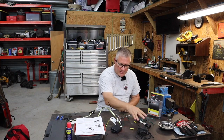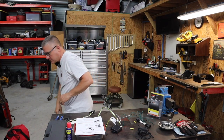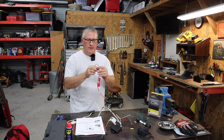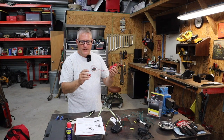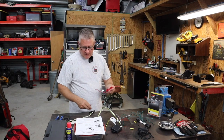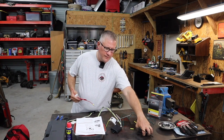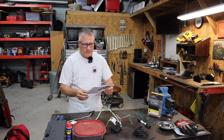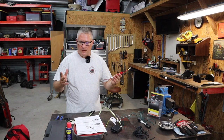This kit comes with butt connectors — that's to splice this black power wire. It comes with the battery connection. So I think the first thing I'm gonna do is go ahead and connect this ring terminal to the battery. I don't have the fuse in it — it comes with a 10-amp fuse that we'll install later. But first thing I'm going to do is connect this to the battery, then run this cable to the back and get that out of the way. That's actually a later step in the instructions, but I want to get it done because I think it's going to be the hard part.